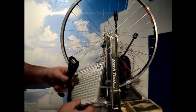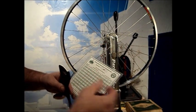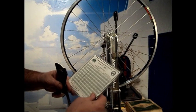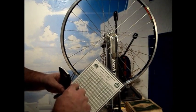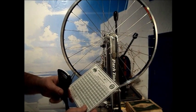To make any sense of it, we have to go to a calibration chart and compare that reading to the line for the particular gauge or type of spoke that we're checking — in this case a 2.0 millimeter or 14-gauge spoke. We get a reading of 80, and that tells us that we have 100 kilograms of force on the spoke. In this case, that's the target for this build.